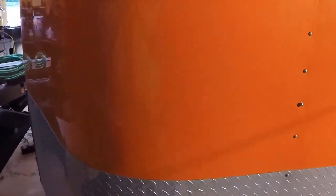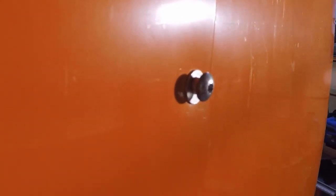In order to mount it on the front of the trailer — it's a round nose trailer — I took some of the original factory screws out, got longer ones, and then I put a little washer and a quarter-inch OD piece of copper tubing on them so I can screw them in tight. They sit there, they look nice, clean, and neat. They're never loose and I don't have to ever move them. You can't even notice them through there at all.